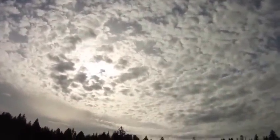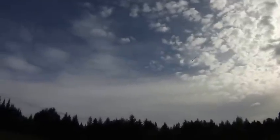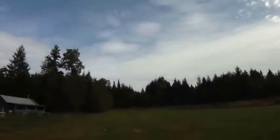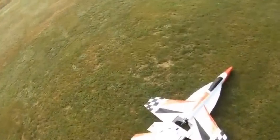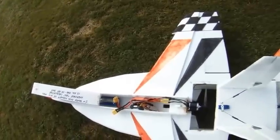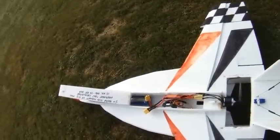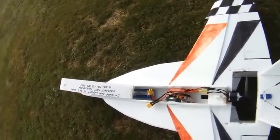All right, well, I think I've seen enough. So there's a 6x4 EMP. Let's see how the motor is. Yeah, motor is a tiny bit warmer. Speed controller is good. Battery's good. So that's a good setup as well as the 6x3 EMP. Maybe a tiny bit faster. I'll have to watch the video. Anyway, I'm going to try and swap out for a 6x4 APC and see how that goes. So hang on, I'll hopefully be right back with you.